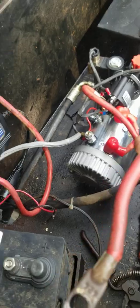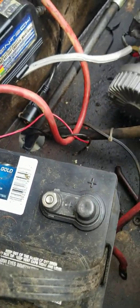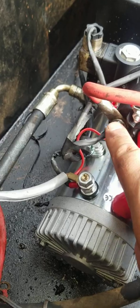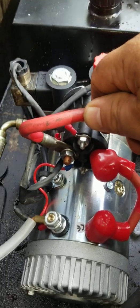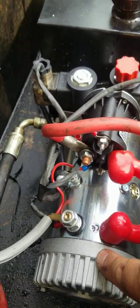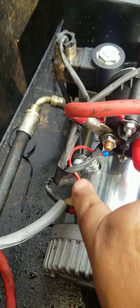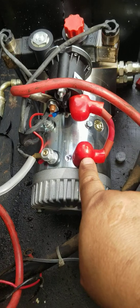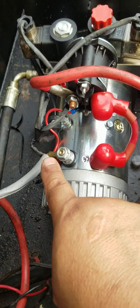You have your power cord — your positive is here, you see this cross — and it goes into the solenoid right here. This nut was actually loose; that's where you put your positive cable, and this is already screwed onto the motor. Then we have another one over here which is a ground — you have to connect this or it will not go. Remember, the one with a cover is positive so you don't get confused, and this other one is for ground.